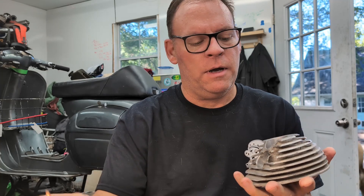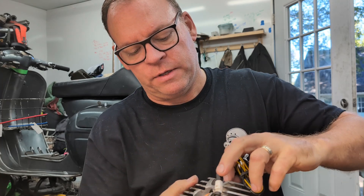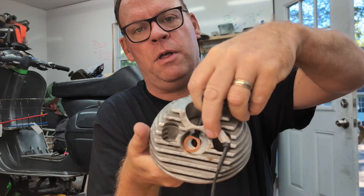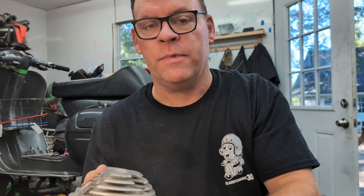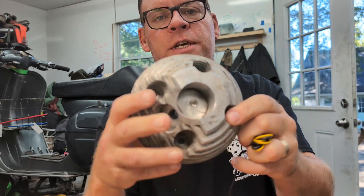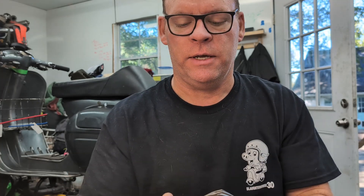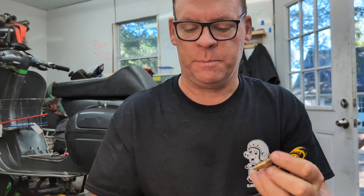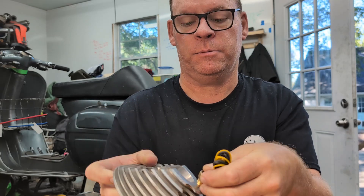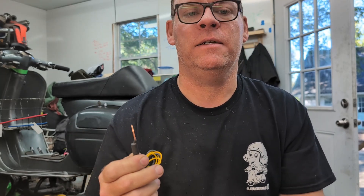The way they fundamentally work: I've got my cylinder head here. The under-plug gauge sits under the spark plug — that holds it in place and gives you the reading. The threaded in-head gauge — this particular cylinder head, off of a BGM 177 — is drilled and tapped right here for it. It's an M10 by 1.0 hole, and it screws in and makes contact with the head to read from there. This is the most common because it's the easiest.